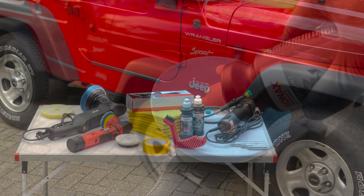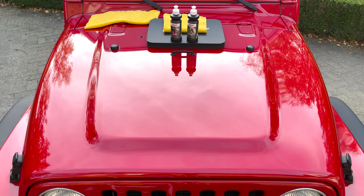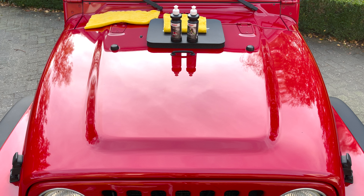We'll use the large DA polisher on the left for large surfaces like the hood and doors. The red compact battery-powered polisher we're going to use in places where the large DA would be very clumsy to handle. We'll also use a medium-sized polisher with extensions and a pen-style adapter piece with tiny pads that will enable us to get in all nooks and crannies without having to polish by hand. You'll also need a conditioning brush to brush off caked up product from your pads while you're polishing, and some painter's tape to mask areas that aren't supposed to be polished like matte rubber or unpainted plastic trim.